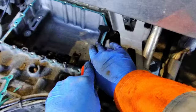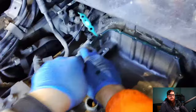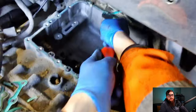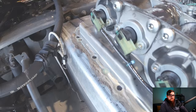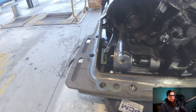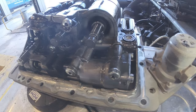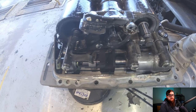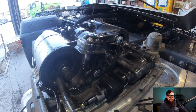I'm working a scraper around the gearbox, pushing the old material and any dirt outwards. At the top of the gearbox between the bell housing and the modulator it tends to collect loads of crap, so I always say to myself I must blow this off before I remove it next time. Here we have the position sensors for the splitter box, main box, and range group positions. This sensor is also for the gate selection position. This is the pressure regulator — we have two seals on the side; the smaller one supplies the transmission brake, and the larger oval one is for the breather of the gearbox. The sensors up here are the temperature sensor and the input shaft speed sensor.